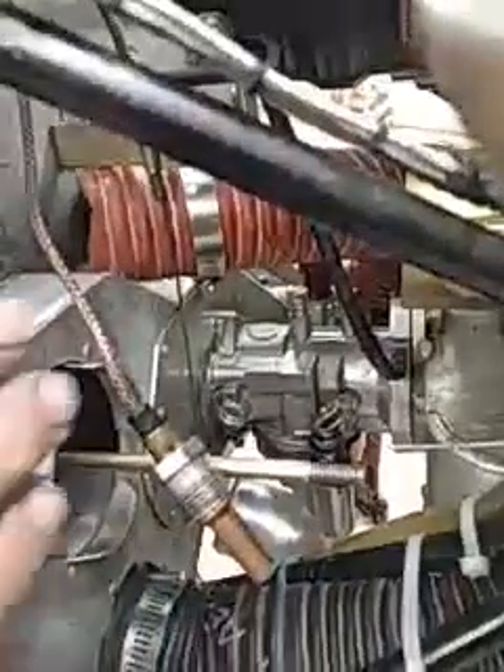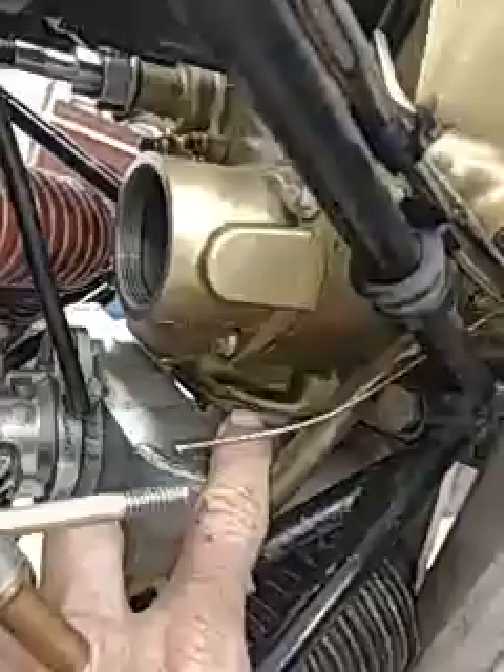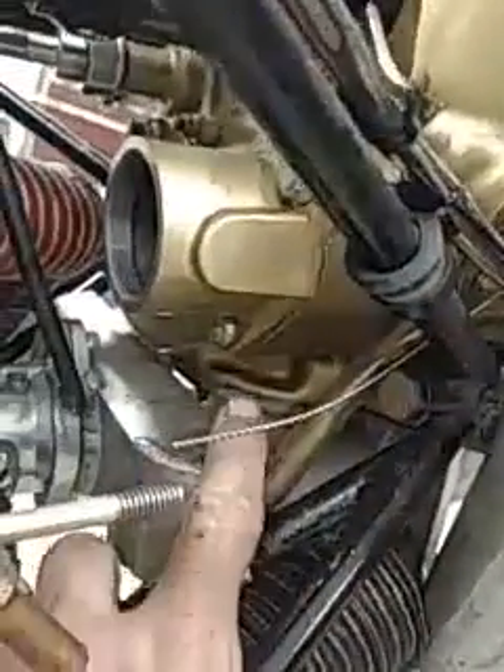It's really tight right now. There's the carb — there's a little Zenith-Bendix carburetor in there. The air comes in and down, and it has to make that corner and go into the plenum chamber right here. It looks like there's a little bit of oil leaking from somewhere — I think it's probably coming out of that pan gasket right there. I don't think my oil pan is leaking; I think it's just the gasket, because I've had that on and off a few times and might have screwed it up.